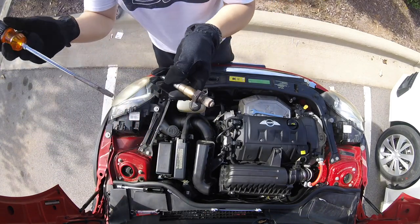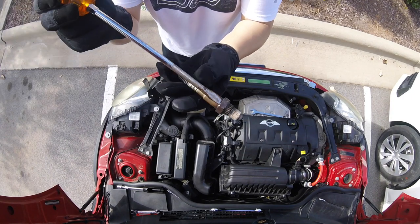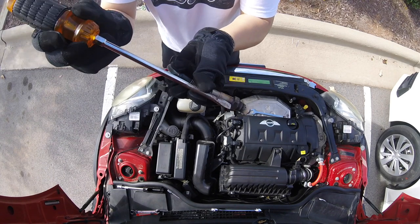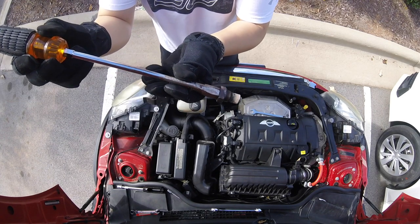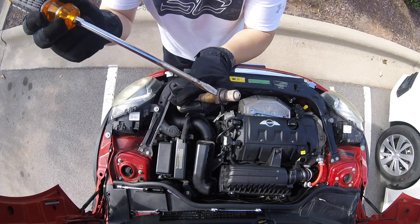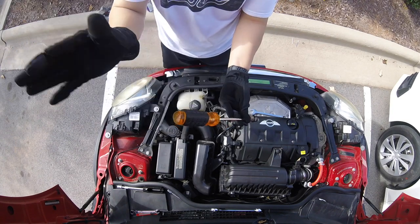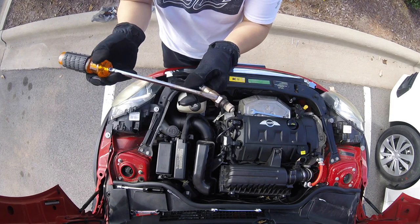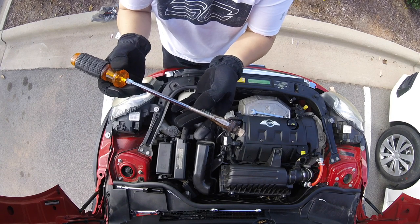What I used to do is strike here — the head of the bolt is pretty solid so it should be fine to hit any spot using a flat screwdriver. Just don't make any holes directly on top of the exhaust, as that will cause trouble. Use a hammer so that you can make it easier to take out the bolt or oxygen sensor which is stuck to the hot exhaust.